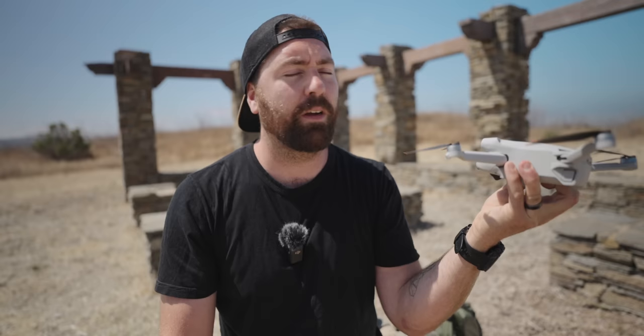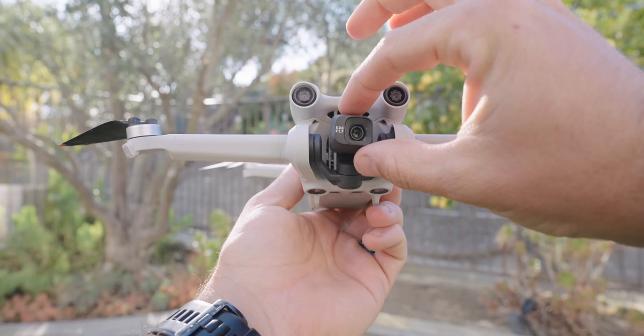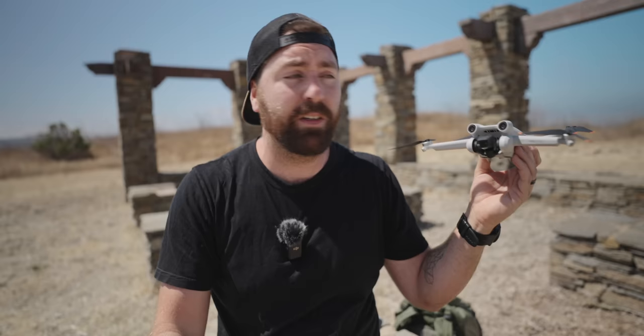On the front of the drone you'll see your gimbal, which rotates in three different axes to get stable footage. It's connected on both sides of the drone, and the camera can rotate both horizontal and vertical. Also on the front you'll see two big sensors — these are your forward obstacle avoidance. If something's in the way like a tree, these two will sense that in front. It's kind of like a wedge shape out front, not sensing things on the side but at about a 45-degree angle in both directions.